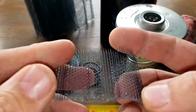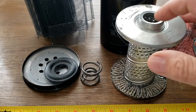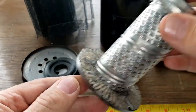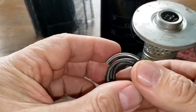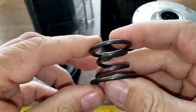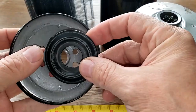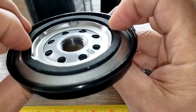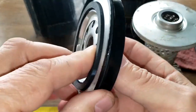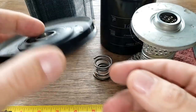This metal backing prevents it from tearing — it's all metal, nice and strong. There's a bypass valve down here with a nice steel coil spring, which is pretty stiff and a good size. As for the anti-drain back valves, these are probably mounted more vertically anyway, so I don't think they do much. But overall this all looks good.